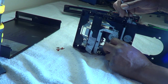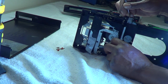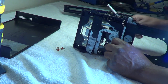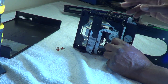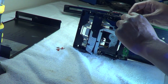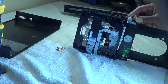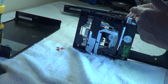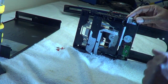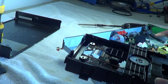By the actual tray coming out that easily, it lets us know that there's no gear stripped or nothing stuck. Do not force it — these are just plastic gears. In most cases I would like to add a little grease on these gears right here, just a little bit, and let it spin. After it spins around it's going to distribute throughout the gear pattern, because a lot of times that's what causes it to get stuck.